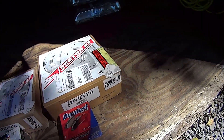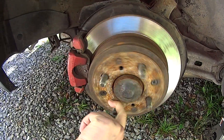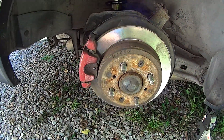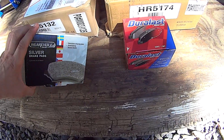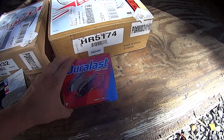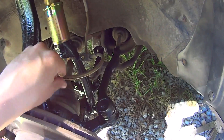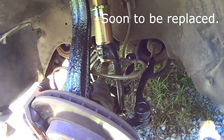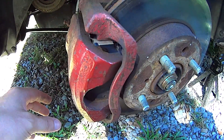I'm getting a pulsation out of the front. The back ones are really old, and the pads on the back ones are pretty much done. Not so much of an upgrade for the pads — I just got the regular semi-metallics. A lot of people run ceramics because they make less dust and less noise, but semi-metallics actually stop you better. I've already got braided brake lines.